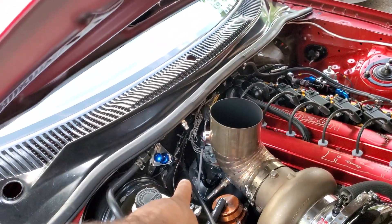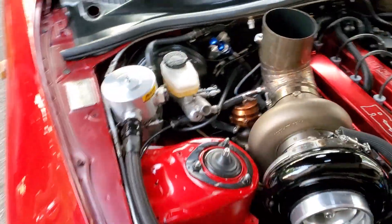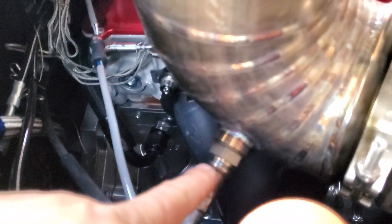Next week Chris will remote in and we'll go over all the fail safes and sensors to make sure everything is good. I've got a 100 PSI MAP sensor - that thing is 100 PSI, so we can make 100 PSI of boost. The transmission is a Rossler TH400 XHD - it still has the stock case but with an SFI bell housing. Next on the list is to change to a Reid case, which is stronger. We've also got MoTeC EGTs and MoTeC LTC - the NTK O2 sensor to read methanol and all.